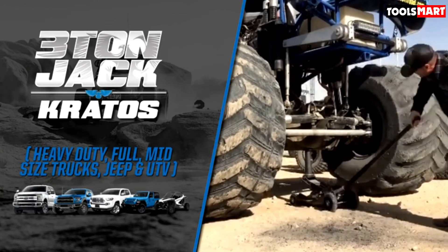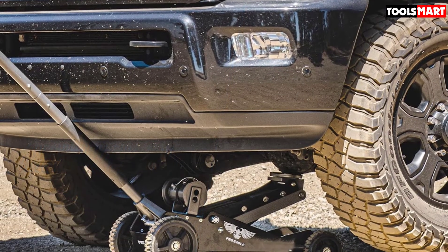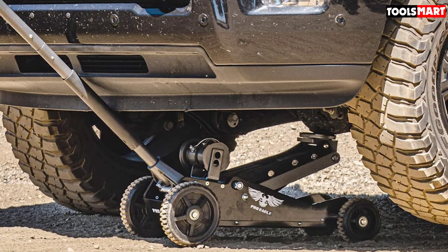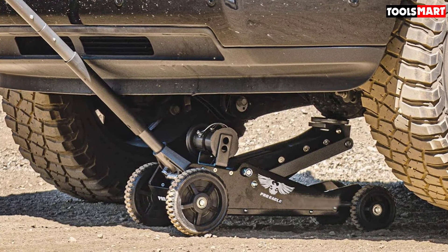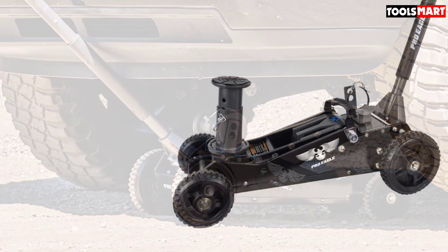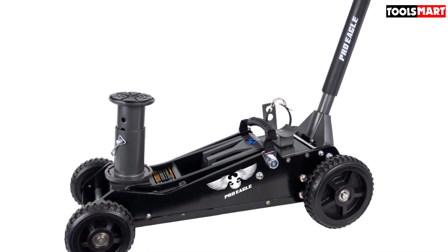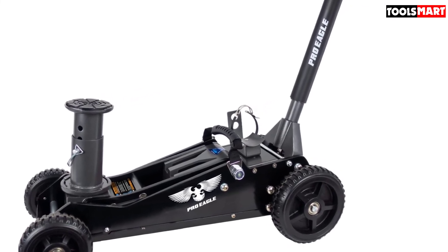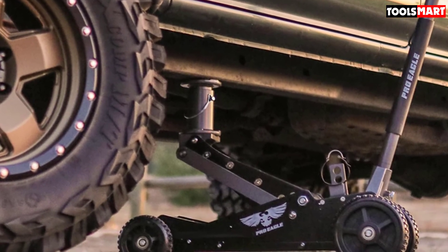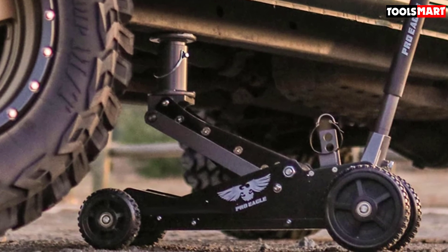It's also designed for rough surfaces, with oversized tires and heavy-duty axles. It comes with an 8-inch adjustable lifting post, and there's an optional additional 13-inch extension if your frame is that high off the ground. It's built with sealed bearings to keep out dust and water, all stainless fasteners, and beefy side plates for stability. The all-aluminum chassis keeps weight down to a very reasonable 60 pounds. The minimum height without the extension is 6 inches, which will be too tall to get under lower cars. The large wheels give it a big footprint — 34 x 15 x 10 inches — so you won't be tucking it away in a tight corner. Some versions come with standard side handles while others have a grab handle, but the mechanical construction is the same. Numerous accessories including mounts, pads, toolkits, and the 13-inch extension are available.